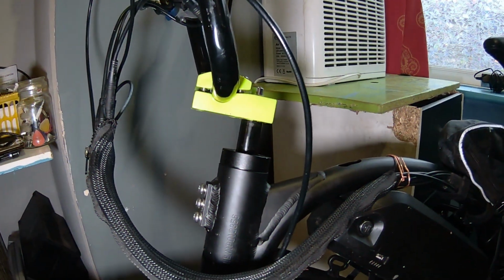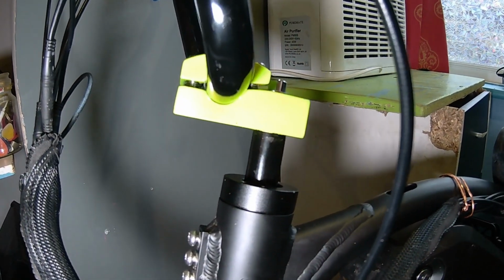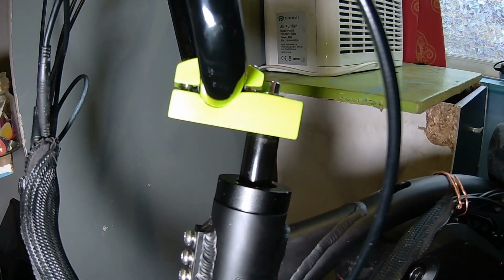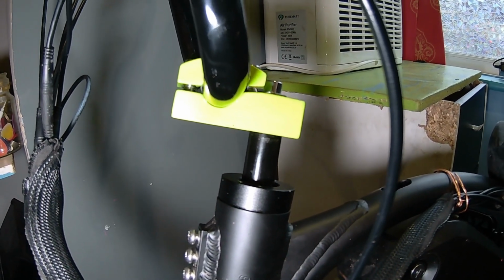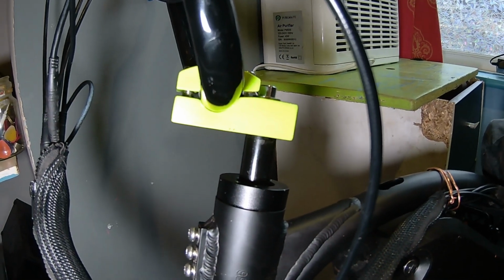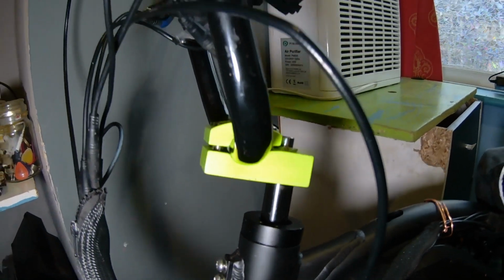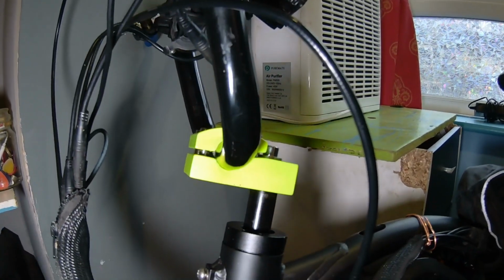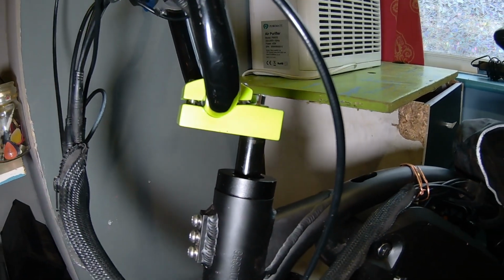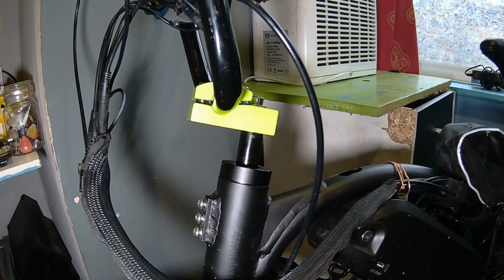So I didn't feel that safe on the ride because I know that I've bodged up this quill stem. So what I've done, I've ordered a quill stem to a head adapter and it'll fit in there, and that means I can put a mountain bike headset on it, so that'll be sorted. Still keep the BMX handlebars, but it'll be a lot safer and I'll feel more secure, or safer I should say. Safe. That's what it's about.